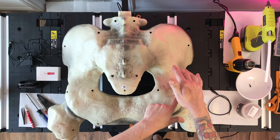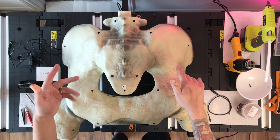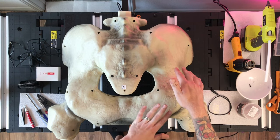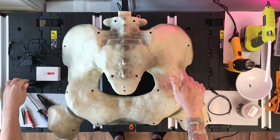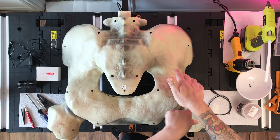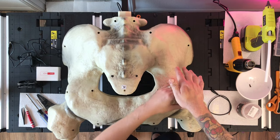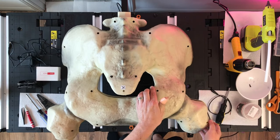What I have here is a screw that was probably slightly stripped during assembly, likely from a pneumatic or electric screw gun. The best thing to do is grab a screwdriver that's a little bit chunkier with a shorter nose so it doesn't have as much of a point, so it can still catch the outer parts of the screw. Push down very hard on the back of the screwdriver and go very slowly — you don't want to strip the screw any further. Next step is to take the back off.